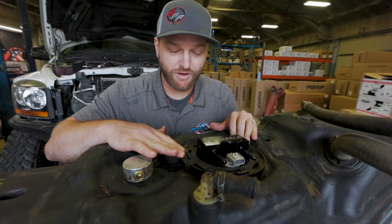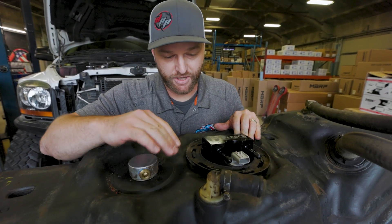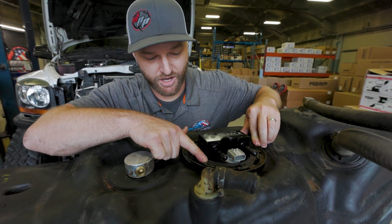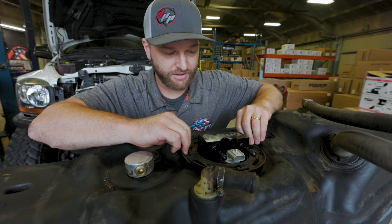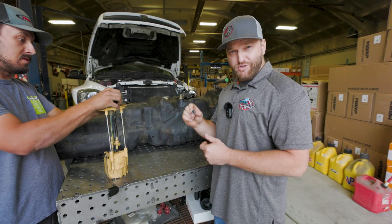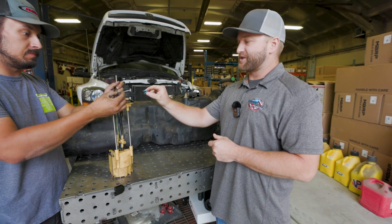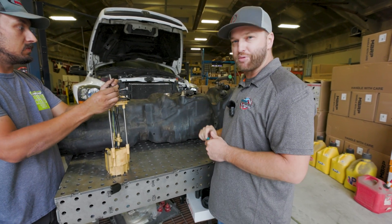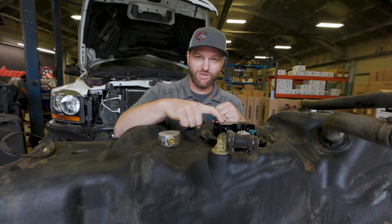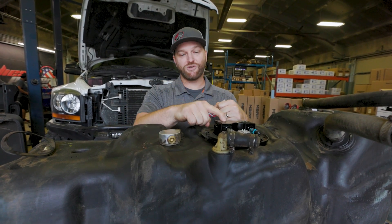Okay, so we had the locking ring in there — luckily Jesse was able to help me out. As you can see, you need to kind of pound it until that notch lines up with that middle part there to retain it, and it's nice and snug — this thing is not going anywhere. A little pro tip: the stock fuel lines use these clips. You're going to want to take them off so you can put them on the new Fleece bulkhead right there. We've got our tank wrapped up — sending unit with the pump inside, the PowerFlo system — so that's good to go.